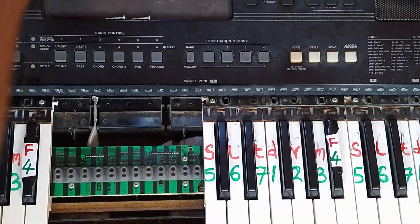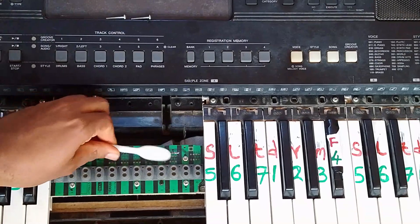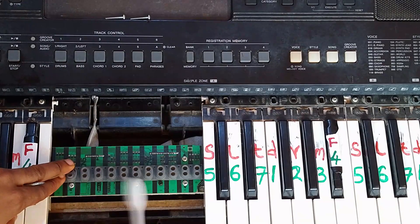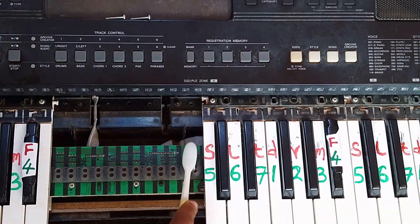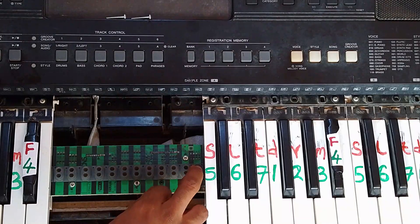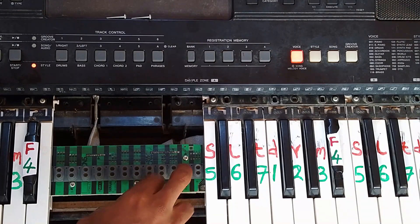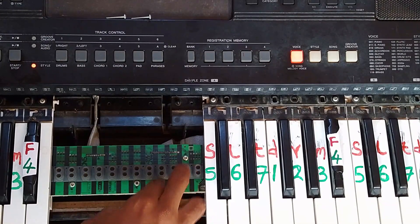What I'm going to do next is take the toothbrush and clean up the surface — those contacts around the rack. That's the first thing to do. Make sure you're using a very soft toothbrush. Even though I already know the problem is not from there, sometimes the contacts can be filled with dust and stop working. Up to now it still doesn't work — about four or five keys are not working.